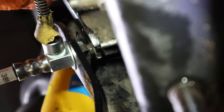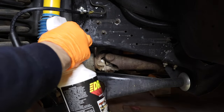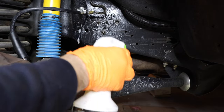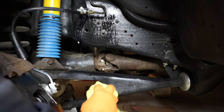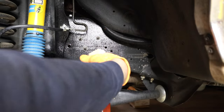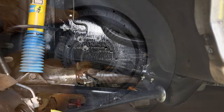Chances are you've got brake fluid a little bit everywhere. Brake fluid is really corrosive — spray some degreaser on the frame rails wherever it came in contact, then wipe it down and dry up any excess brake fluid, otherwise it'll strip the paint off the frame and may lead to rust. Make sure you go inside the rail where it was dripping. I like to finish it up with some WD-40 sprayed in there — gives it a finished look and some protection.